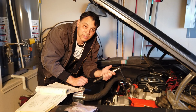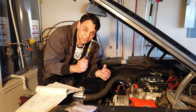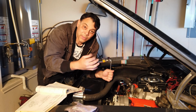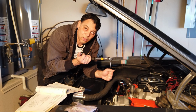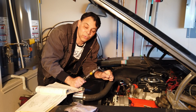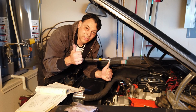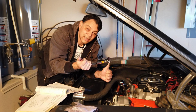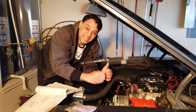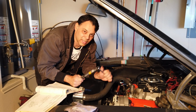Once upon a time, I actually worked at Boeing, and I was an inspector over some of the mechanics. One of the things they teach you at Boeing is if you're going to be torquing something, I know how it is with shade tree guys and even car mechanic guys. You go in there and you hear your first click on the torque wrench, and you're like, oh okay, let's double check and then give it another click. What happens is at Boeing, they train you that at the second click, you've already gone too far. So the first click, as you go nice and smooth, once you feel the click, that is the appropriate torque. When you give it a second click, what ends up happening is you have to over torque it in order to break that bond, that binding of the nut, and then it breaks loose and you get another click and now you've over torqued it. So don't do that. Stop on the first click.